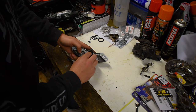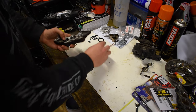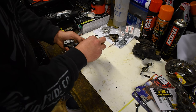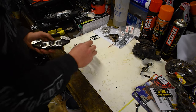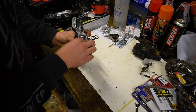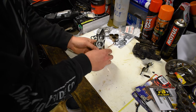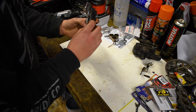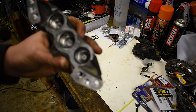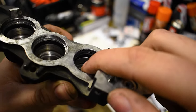And then you want to do the bigger piston main seals. Done, and then this one, done. So then you just want to put in the dust seal. Again, very straightforward. These ones sit way more lightly in place, but still very straightforward. So they just kind of sit down into the groove a little bit deeper. I'll try to show you better. So just there, they kind of sit just down under the top, and then the main seal just sits down in there, like that.